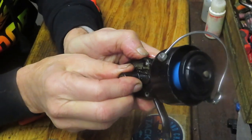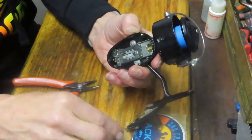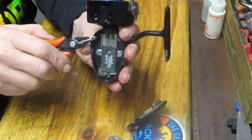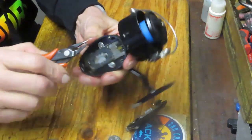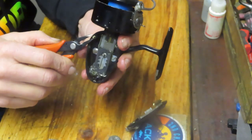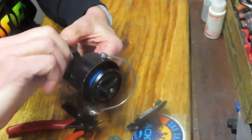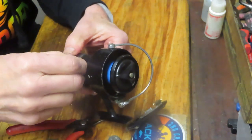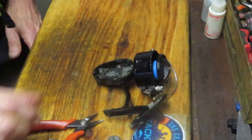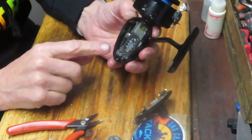Now when you remove the side plate — there you go — you'll see a stud that's still there. That's why you don't drill all the way down. Take your pliers or something to grab that stud. Hopefully it's not stuck in the case. It was stuck in the case, but you can see how it's walking out. And that's it — there's your stud that was lodged in there.